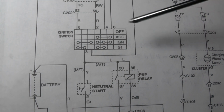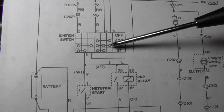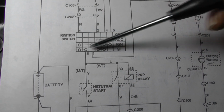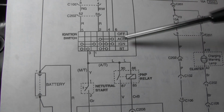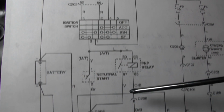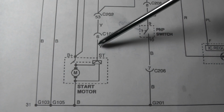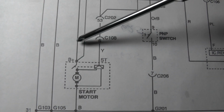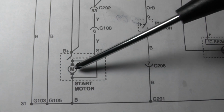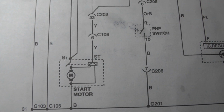So I don't want to turn the ignition key, and I could disable ignition. I could disable the relay and pull the fuel relay out or pull the fuse out. So what I'm going to do is keep this ignition switch off. All right, so here's how we're going to turn the engine over. With the ignition switch in the off position, we're coming down here, so I need 12 volts right here. So I'm going to take a remote starter switch, and I need 12 volts to come from here to go to here, get 12 volts, turns the starter, and that will turn the engine over. Therefore, no fuel, no ignition will be going to the spark plugs, which is what I want.